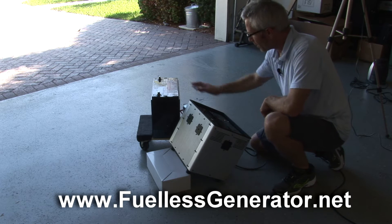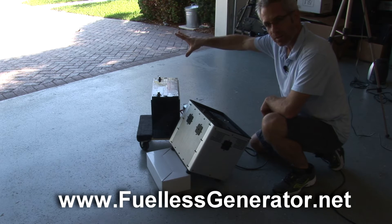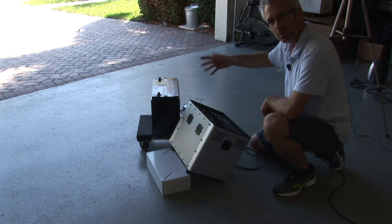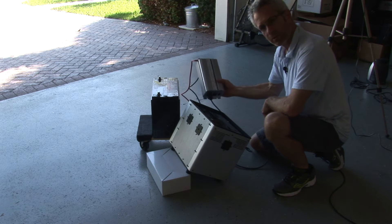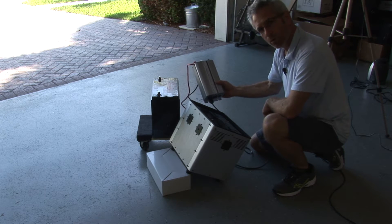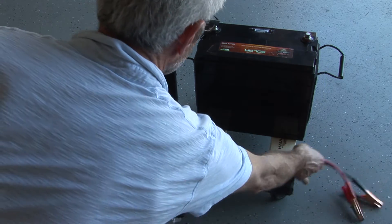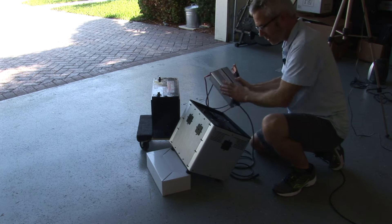Some people want to be able to charge their L1500 or other device with a battery source. How we're going to do it is use the 12 volts from here, whether it's in the car or not. If it's in your car, keep your car out of the garage. Keep the hood open, keep the AC and heat off. In the middle of summer, keep that hood open and keep air blowing so your car doesn't overheat. Then what you're going to do is basically have an inverter. This one's rated at 1250 watts continuous. I've tried smaller ones — they don't work very well. You need at least 1,000 watts of power. I went to 1250 because this particular inverter with a decent 12-volt source connected to these alligator clips is going to give you a good 900 to 1,000 watts of energy, which we need to charge as quickly as possible.